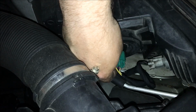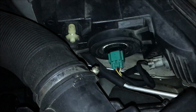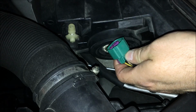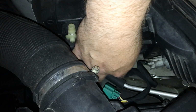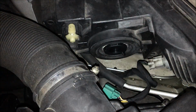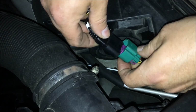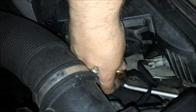And then to remove the headlight, you just rotate it counterclockwise. Then it comes right out. Press the green tab, and the bulb comes right out. Okay, so take the locking collar from the bulb itself, and you're going to insert this first. It is very critical that you do this in the right procedure. You put in the collar first, and then you take your bulb and make your connection. Snap it in, and now you're going to insert the bulb into the opening.